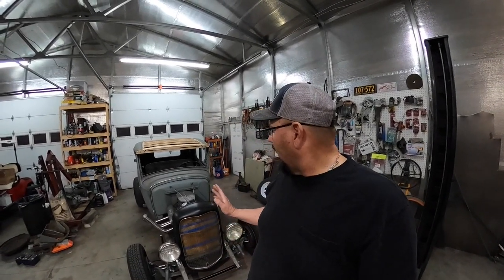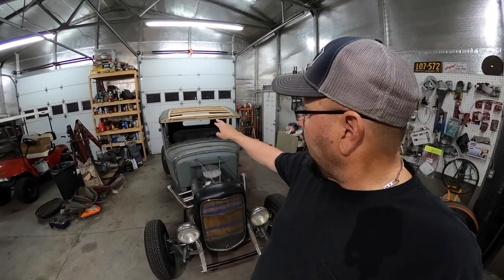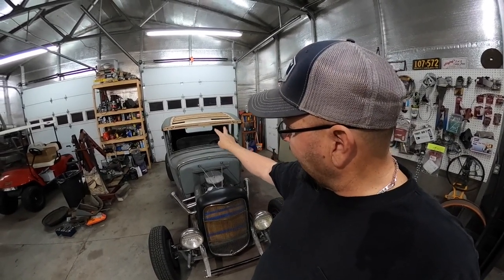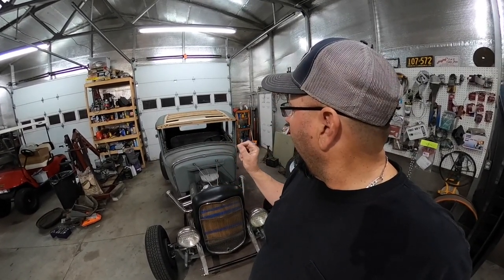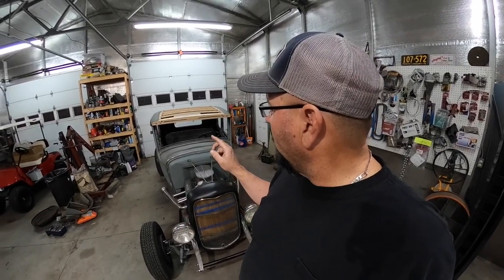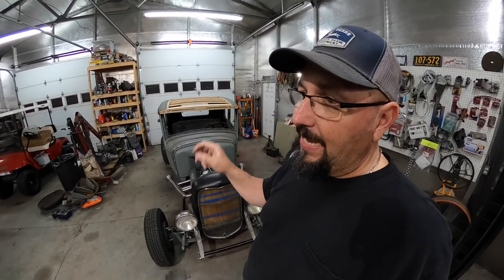I have been working on the Model A a little bit, and I put the top wood kit in. I've got that in now, and I've got the wood back around the quarter windows and the piece that goes around the back glass. My top part's good, but the two pieces that go beside the back glass and under the back glass are bad. So I didn't order them, but with the top piece being good, I've got some oak wood and I'm going to make the bottom piece for the back window — the lower bottom and the two sides. They're pretty straightforward.